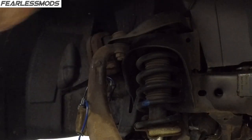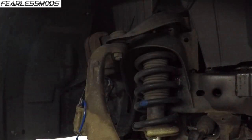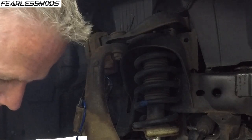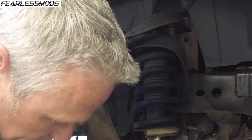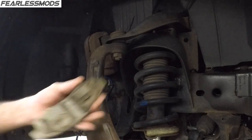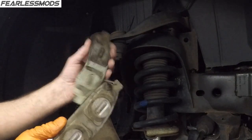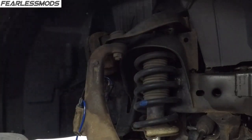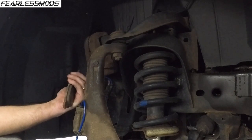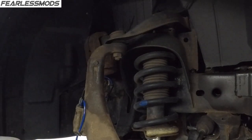Okay, so another little trick I want to show you. So first off, if you can't remember which pad went on which side of the rotor, it's as easy as looking at your old pads. So there's one with a squeaker, a wear indicator. I wasn't down to it, but I was getting pretty shallow. And there's one without. You can tell in here the one with the squeaker was where the round pucks are, which is on the hydraulic line side, the brake line side, and then the square ones, which are just out here on the stationary posts. So the squeaker goes on the round side.